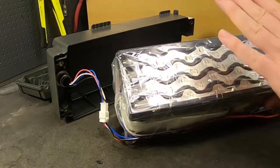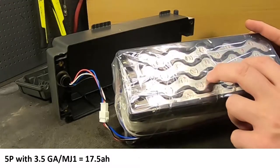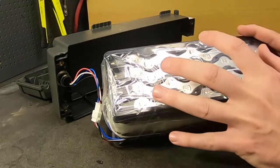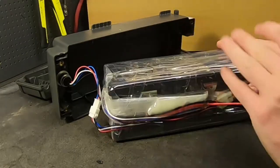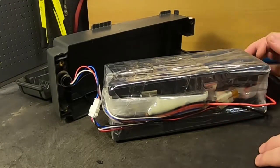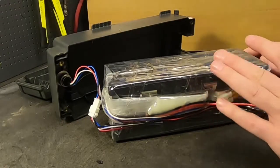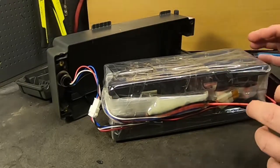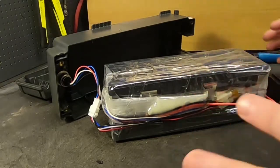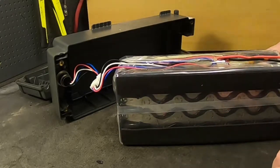Because that also limits me to the number of cells — I could only do 17.5 at the max with modern cells. But I'm going to transfer this battery into 25 amp-hours. Because apparently Giant makes good electric bicycles, even though they were not that popular in Sweden. They are apparently very good, so the customers almost always choose the highest capacity. And I can offer them 25 amp-hours, which makes them one of the biggest 24-volt batteries in the world for standard 250-watt e-bikes.